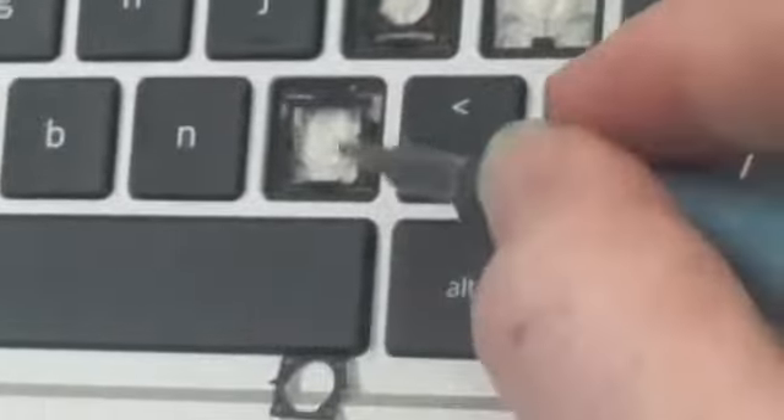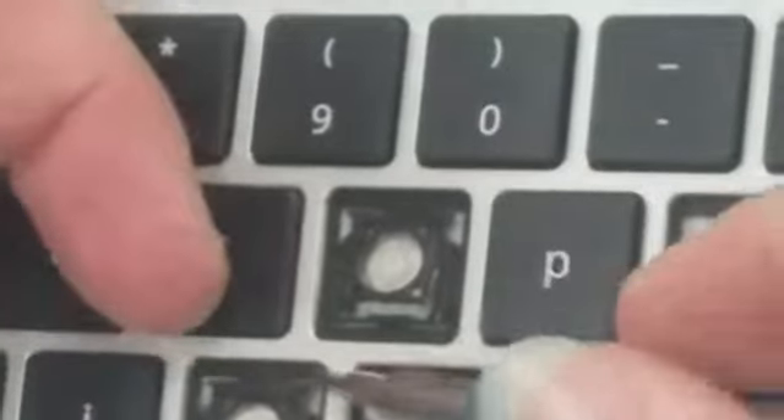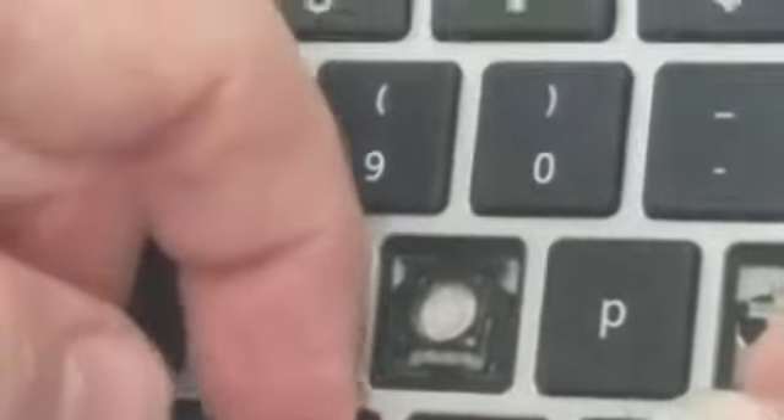So we have the key, and now we need the cross piece. This one is already coming apart, so I'm going to steal one from another key — as long as it's the same size, it shouldn't matter. I hold this up a little bit, and with this model that helps to release it off these hooks. So I bend it down and lift up so that it's released, then do the same on the other side — bend it down and free it from that hook. Once you have both of those off, you're good to go.